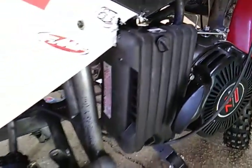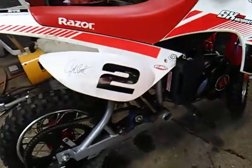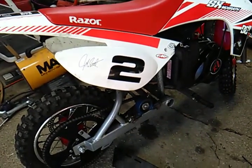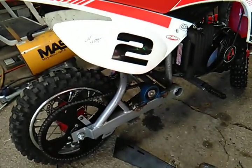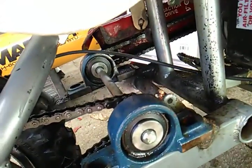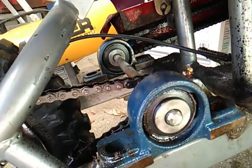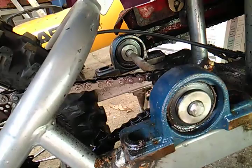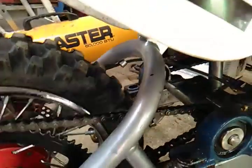What happens is the Razors — they come through the sprocket on the other side, because the electric motors they use are reverse rotation compared to a gas motor, so that makes the job a little more challenging but not too bad. What I did was take these — they're called pillow bearings, they can be had on Amazon for about five bucks a piece. What this does is reverse the direction of the drive.